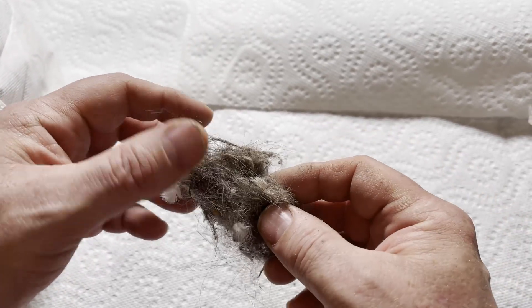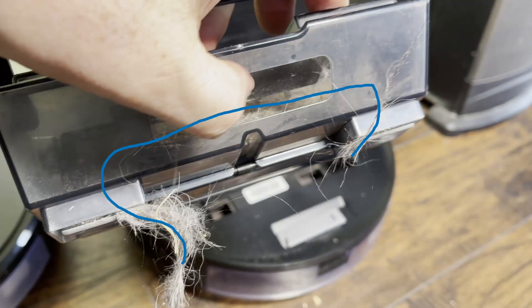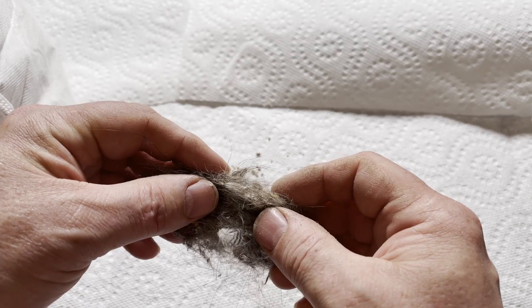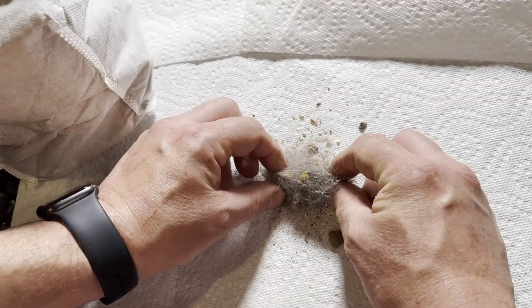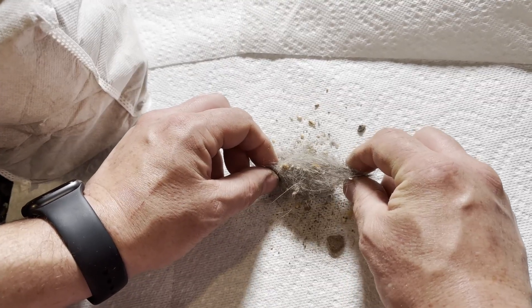As you know, the T8 dustbin pulls the dirt out from two different ports. So in this photo what you're seeing is one solid hair clump, which is what happens inside the bin, and it's being pulled from two directions. So in order for that to succeed the suction power has to be sufficient to rip the clump in half, and it isn't, depending on the type of hair you have. So when it pulls from two directions it can't get it out.